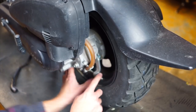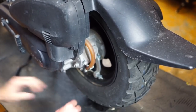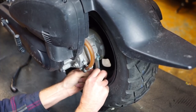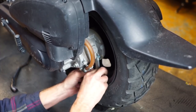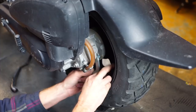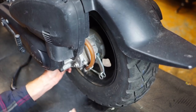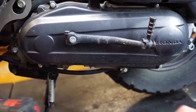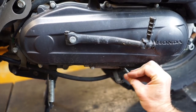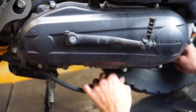Back here on the stock motor, you've got the rear brake. You'll know that because you push this rear brake lever and you're moving the arm. I'm going to hold this arm in manually with my hand and then I can loosen this — that's a 14 millimeter. Pull that off of there, and then there's this little cam you can pull out. Right below the kickstart, eight millimeter. Pull that loose. You can pop it back in when you're finished if you'd like. Now I can pull the cable out.